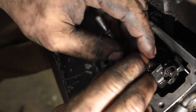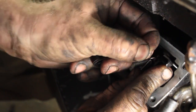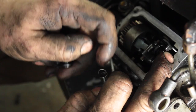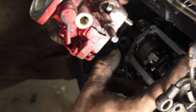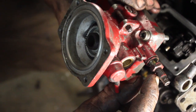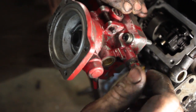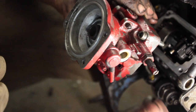Very simple - just pull it out and make sure everything's clean. This is our donor 5.9 and this pump is no good, so you want to pressure wash that, pull that spring out and pop your new one in. To put it back on again, pull your fuel pin out so that it doesn't hit this. When it's in, you can count the threads that were left, measure the distance, or if you're confident enough, crack the nut loose, spin this out, and putting your nut back in the same spot will give you pretty well where you left off.